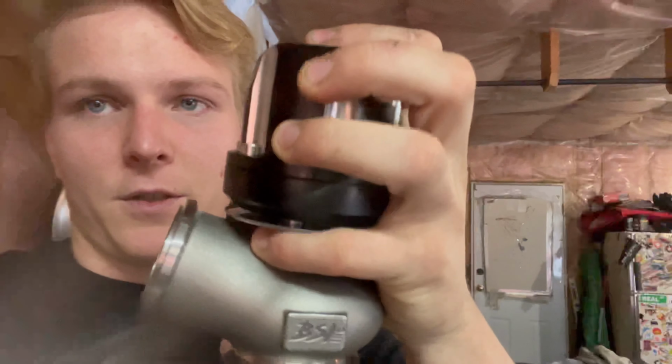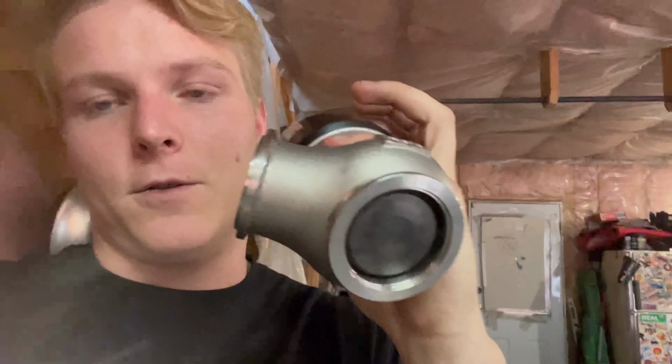Imagine if we have 14 pounds of pressure in the exhaust manifold, which is gonna push this valve open. Then we start adding some boost to the top, and it's going to start pushing this valve back down. So if you put 14 pounds of boost to this top, it's just going to stay closed, obviously, and then you'll build way more boost. There is a point though where you can essentially max out the gate. You can run a line to the top of the gate and have a max spring pressure in there, but it'll only still build so much boost. You'd probably build 45 or 50 pounds of boost, but that'd be kind of maxing out the gate.